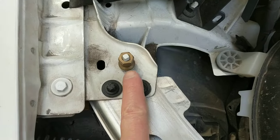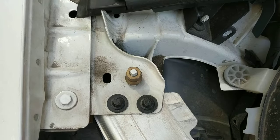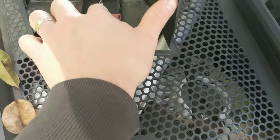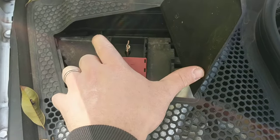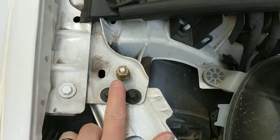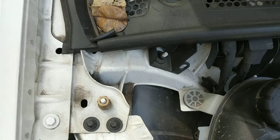For the negative, you're going to want to ground it out, and there's a handy little grounding post here for the negative. So when you are going to be jump starting the car, just make sure to pop open the cover, slide back the little red terminal flap, connect the positive cable to this one, and then the negative cable to this post right here, and it'll allow you to jump start the car.